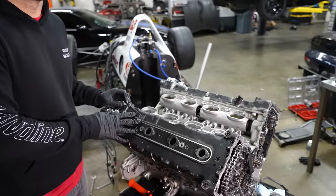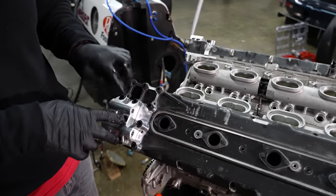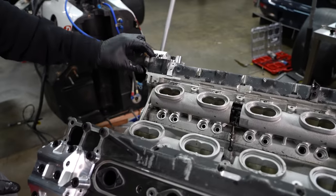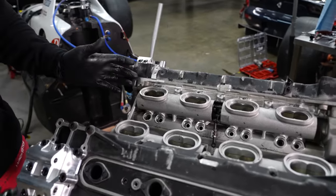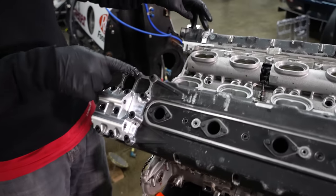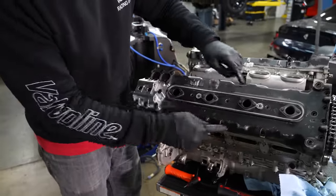This is the upper chassis we're taking off — now we're going to take the valve cover off. What is mind-blowing to me is that when I made these engine mounts, I made them with as much precision as I could. When you look at it from the backside, you understand why those bolts are so much deeper — they don't go into the valve cover, they go into the head, with the edge of the cover being held down to the head. And that's actually done with the engine mount, which is the chassis.